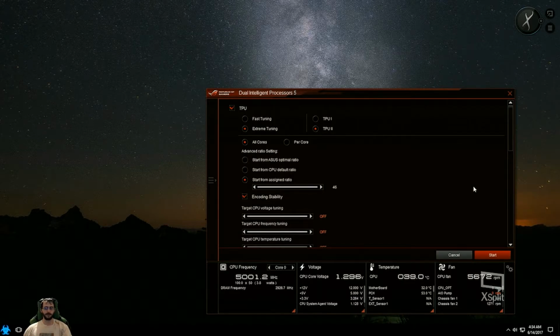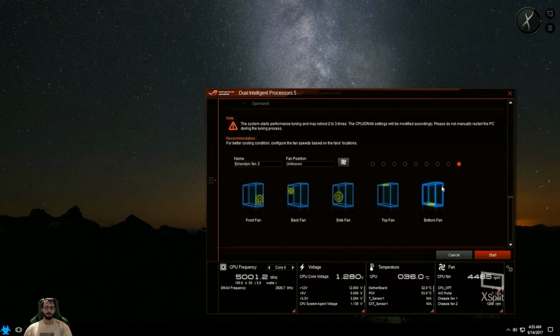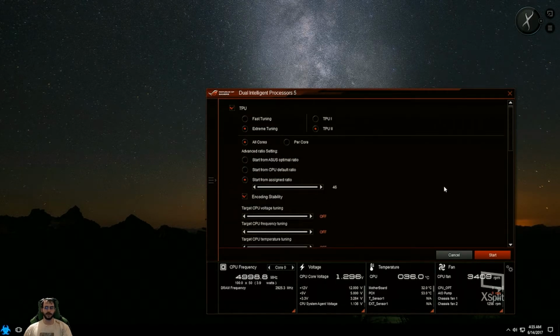And then for fun, you can mess with your cache ratio multiplier on your CPU if you haven't done that already. And when all that's good and done, then you can mess with your voltages and try to drop them one step at a time to get more heat under control, because the less current running through that CPU, the better for heat control.